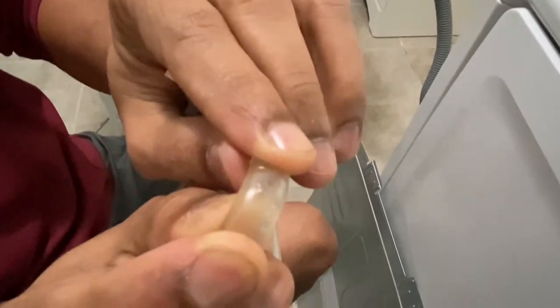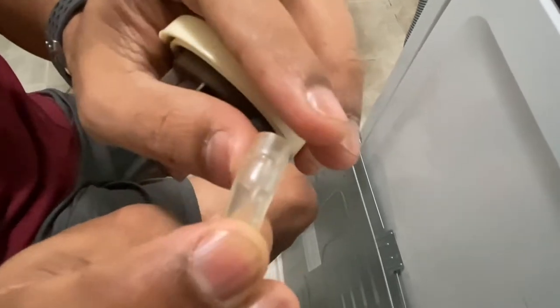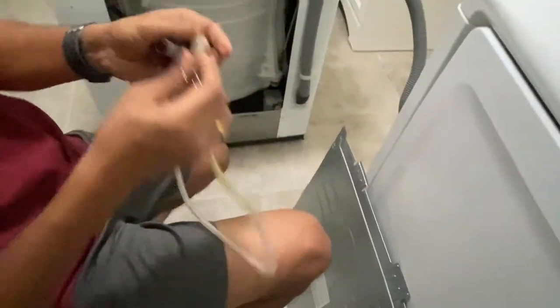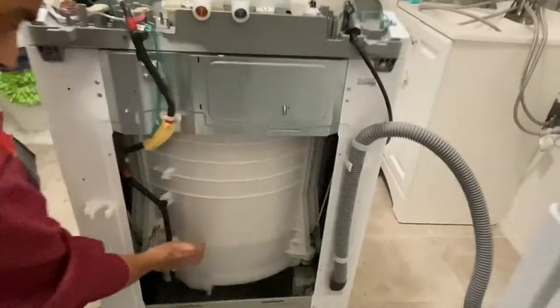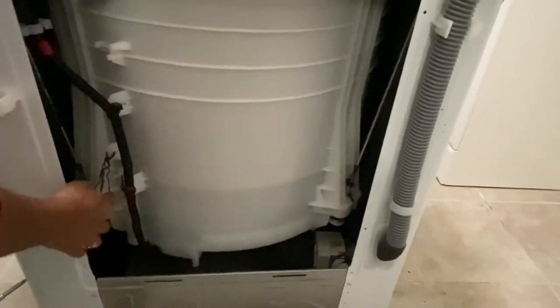As I mentioned, if the problem were with the pressure sensor you'd just remove this tube and put in a new sensor. I actually did buy a new sensor and put it in, but after turning it on there was still a water leak. So we opened the panel again and took a closer look. At the end of the tube where it fits onto the tank, there is a little cut — due to wear and tear over five years. When the water fills the tank to the point where the tube is attached, pressure builds and the water was coming out through that cut.